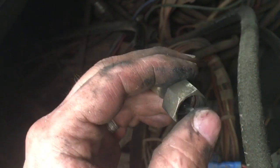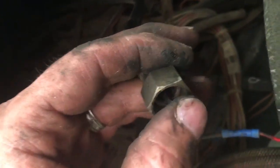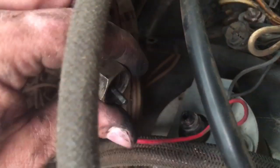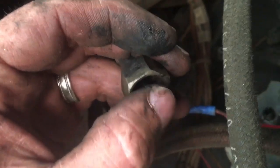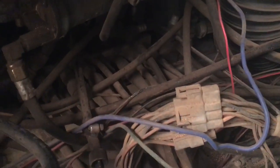The tach has been intermittent — it's actually a mechanical drive, an old speedo cable that comes right off the injector pump. It looks like it's turning, so maybe it hasn't been reaching far enough in, or it's just sticking. I'll put some silicone in there and see if I can get the tach a little more consistent. As you can see, it's just a ton of hoses that are going to need to be replaced — you can hear another one hissing. The best thing to do is clean all this mess out and replace the lines one by one so it's done right.